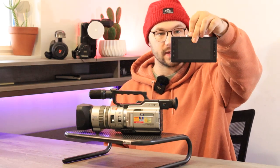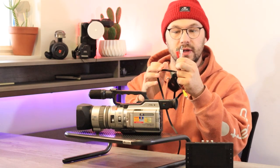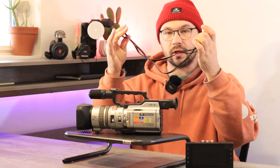What you'll need is a working camcorder, your converter, and either RCA or S-Video cables if your camcorder supports S-Video. Keep in mind that S-Video cables don't carry audio — they're video only. So you'll still have to use the red and white RCA plugs to get your left and right audio. That means running two cables, which is a bit more bulky, but you do get a slightly better image out of S-Video than RCA. For ease of use, I'm going to use the RCA cables to explain how to put this all together.